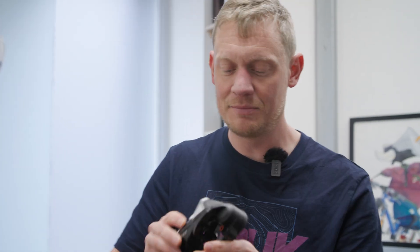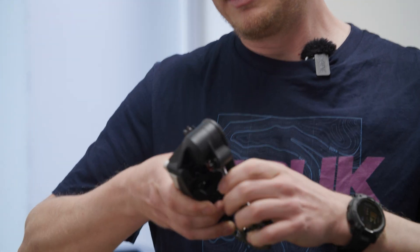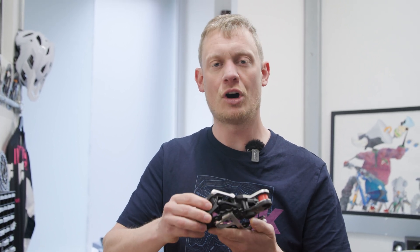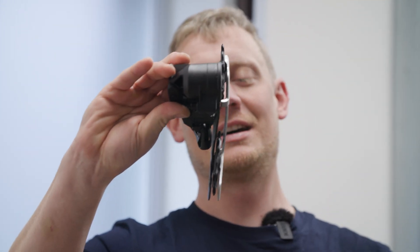In the knuckle you have the same Type 4 damper - that's the clutch system - and it's the same one found on the electric derailleurs. The Eagle 70 version has a slightly cheaper drag spring in there just to keep costs down. If you look down the mech you'll see the derailleur cage is a little bit bent, but it is meant to be bent - that's the same thing you'll find on Transmission.